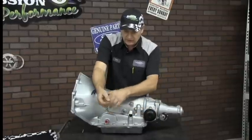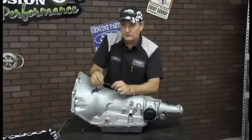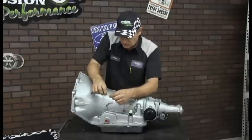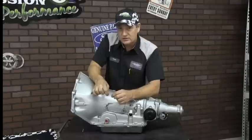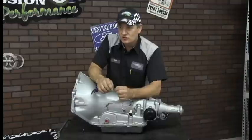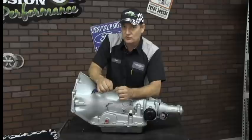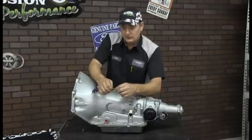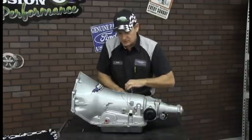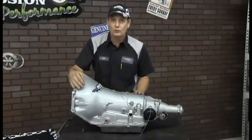The other wire, this is what you're going to test with. This is your positive wire. So the wire coming down from your toggle switch that's energized, you would strip this wire and touch this wire with the power source. You should hear the solenoid click. If the solenoid clicks, then it's active and works. If you do not hear a click, you may have a defective or bad solenoid. You need to repair that for the circuit to work. If the solenoid clicks, then you run this wire over the case to the other side of the transmission, where we'll put in our pressure switch. So now I'm going to rotate the unit and show you how to wire in the pressure switch.